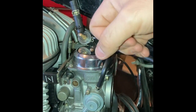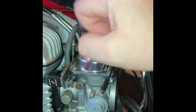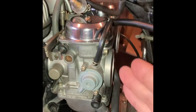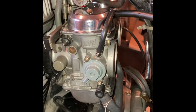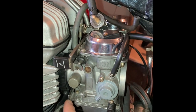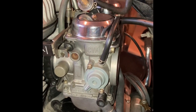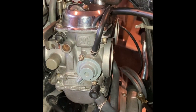Remember, you have to do this when the engine is fully warm, not on choke. Shut off the choke and do all these experiments with a really warm, hot engine. On a warm engine, if you blip the throttle and the engine wants to die — you blip the throttle, let go, and the engine kind of wanted to die but came back — that means the mixture is too rich. So you need to use your idle screws to control the mixture. In my case, when I started the bike it started fine but it was a bit too lean, so I set the idle screws to two and a quarter, essentially two and three-eighths out on both cylinders.